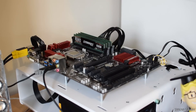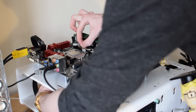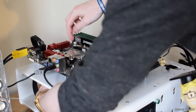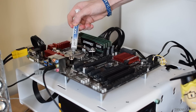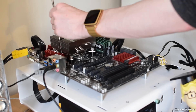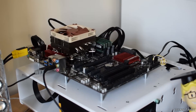Moving on to the installation of this cooler onto my test rig — you'll want to start off by securing the included black metal backplate on your motherboard and placing the four washers over the bolts. With the washers in place, you can place the two mounting bars on top of them and screw down the mounting bars with the four thumb screws. The last step is to add a little thermal compound as per the manual, and screw down the cooler with the two pre-attached screws. Overall, this cooler is very easy to install, like many other Noctua coolers I've installed in the past.